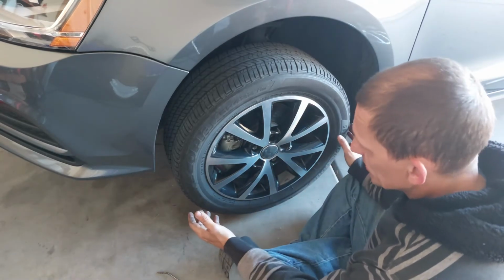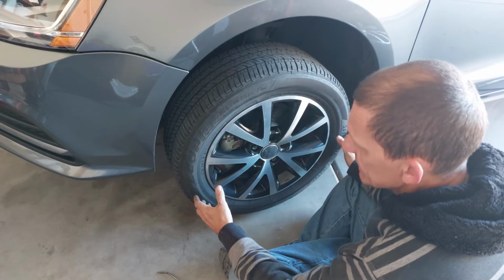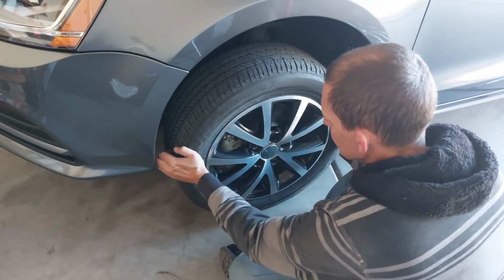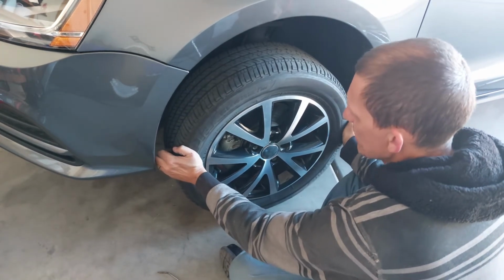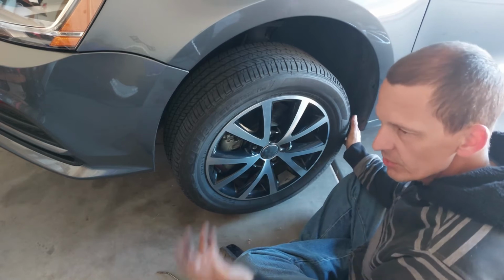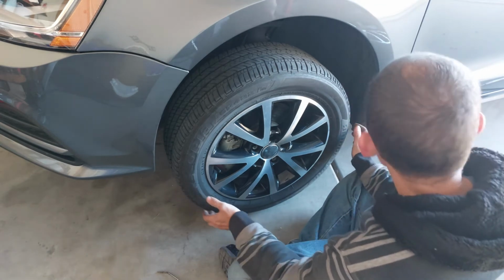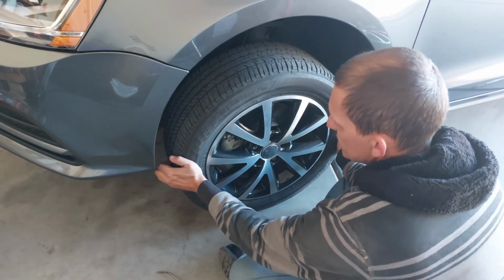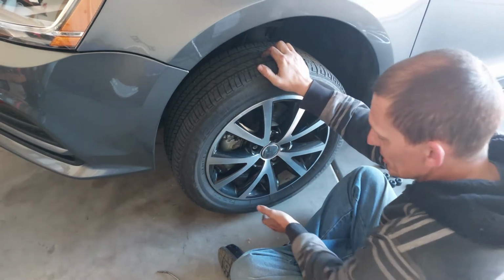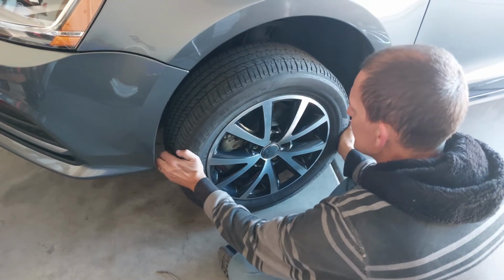Before removing all of the lug nuts, we're going to test the front suspension and see if there's any play. We always start with the bearings, and right here there is movement, but that's natural movement in the rack and pinion, the steering mechanism. We always do a quick short wiggle up and down too. That's why the car must be supported well, because once you stick your hand under there, you don't want this car to fall on you. But I see no bearing issues.